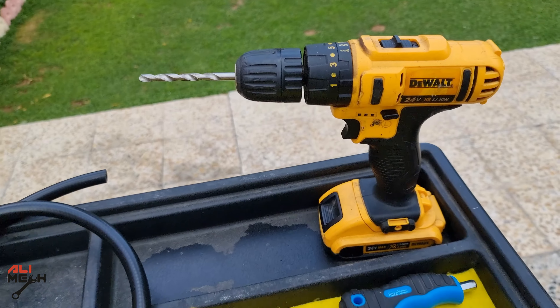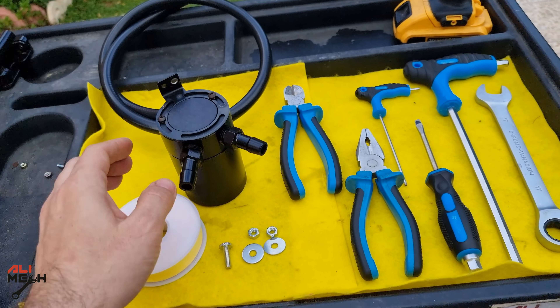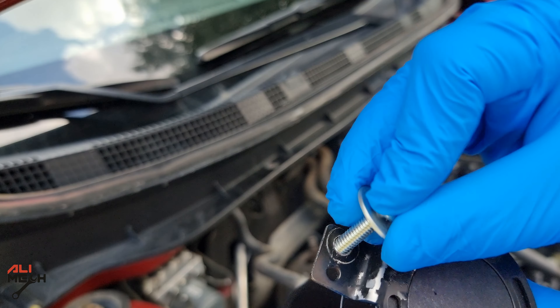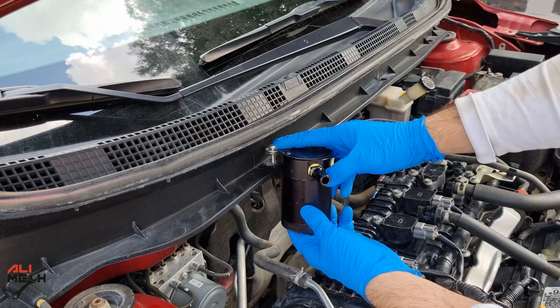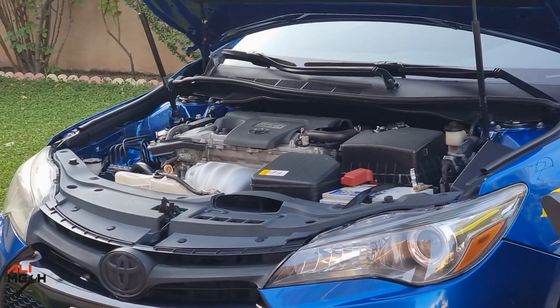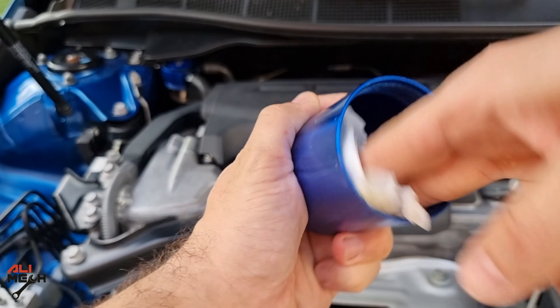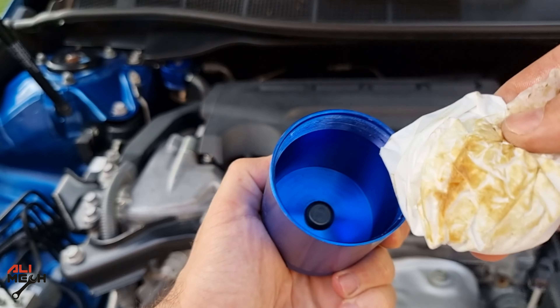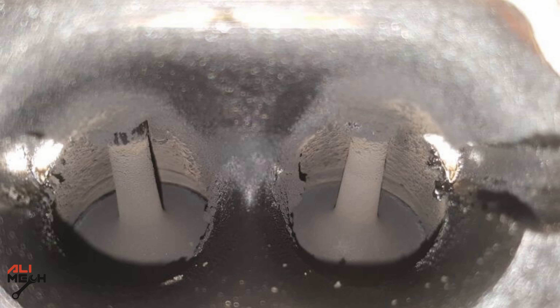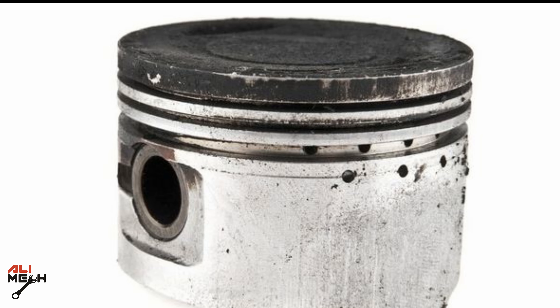With the installation like this you will need common hand tools, and I also have a drill here with a 6 millimeter drill bit so I can make this bracket hole bigger to use a 10 millimeter bolt for fastening the oil catch can somewhere in the engine bay. I have installed the same oil catch can on my other two cars and they've been working very good for catching all this oil vapor.